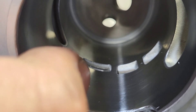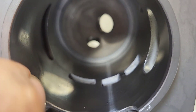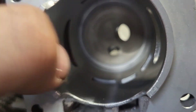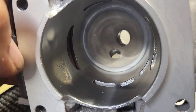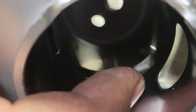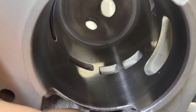Fire the primary first — starts to loop scavenge, pushing all your fuel-air mix toward the intake side. There's already suction from the exhaust, or I don't know if it's suction or if there's just pressure escaping through the exhaust. So everything in that chamber is trying to pull that way. That's why you want to fire the primary in the opposite direction that everything is trying to flow — that's part of the loop scavenge in this engine. From there, I want to fire that intake side secondary, then the middle secondary. Primary, intake side secondary, middle secondary. That's the plan. Will it work that way? I don't know — we'll see when I get to start grinding on it.